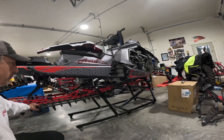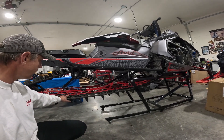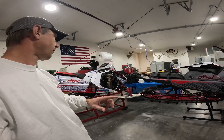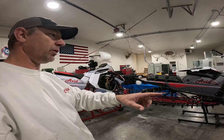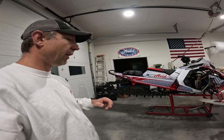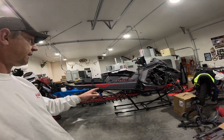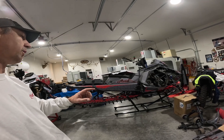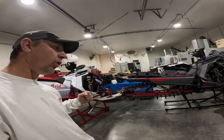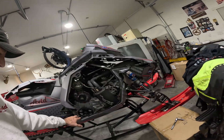My Avid spec tension has the track hanging down about a half to three-quarters of an inch at rest — roughly the height of the drive bump. That looser track improves performance, and we need a bit more room in the front of the bulkhead for snow evacuation and centrifugal force. I've got a fish scale we're going to hook to the track and pull it to measure the force required, and I'm also going to put a torque wrench on the bottom bolt to see how much torque is needed to rotate the track.